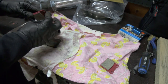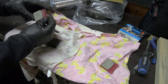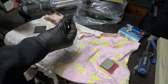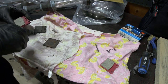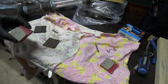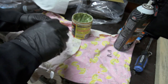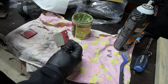I'm going to clean all this up because it really should be fairly lubricated. Once you've got your stuff cleaned up, basically you're going to be sliding your pins through and then using your spring clip here to hold them in place. But we're going to have to do that on the actual caliper. So I'm going to go ahead and clean this stuff up, brush this down, probably clean this backplate a little bit, and then I'll install them. I'm going to put the wire brush to my springs a little bit — you don't want one of those breaking from being too rusty.